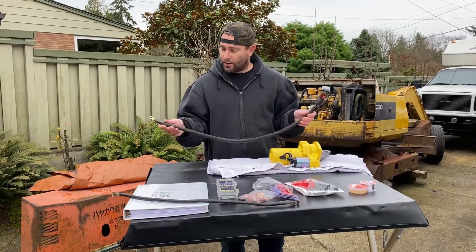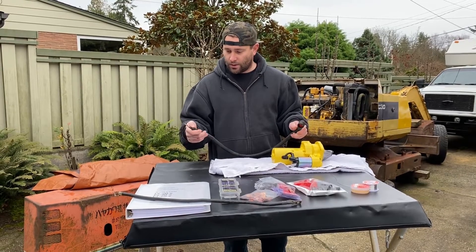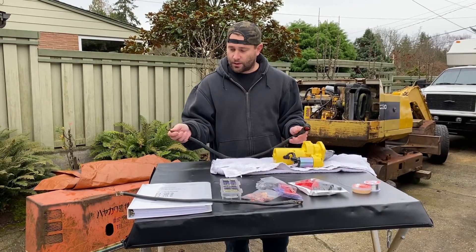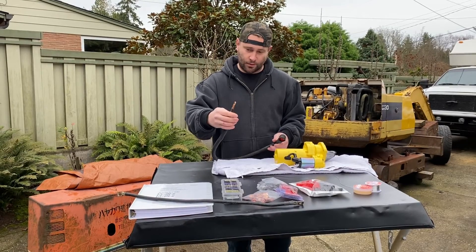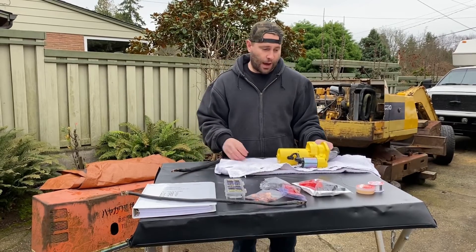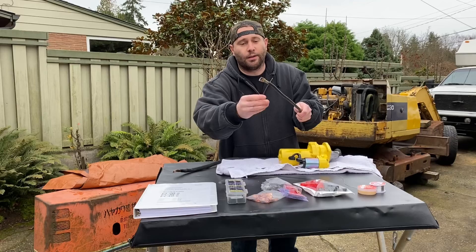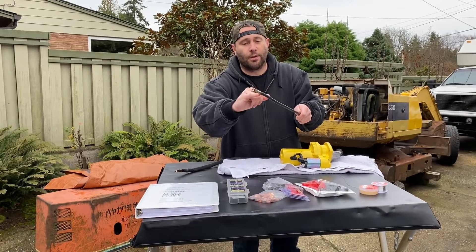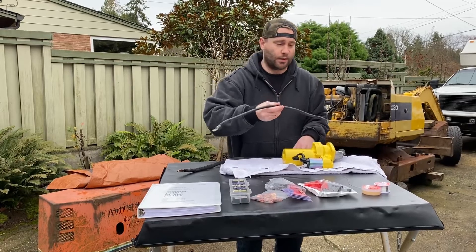Made new ones — all copper zero gauge. You just crimp these battery terminals and then shrink wrap them. If you have a big gap in between, I like to heat that with a torch and then put some solder in, but this is a bad one too.